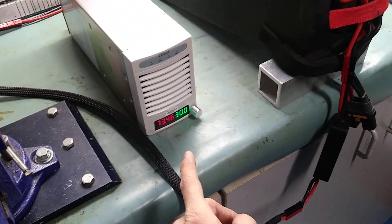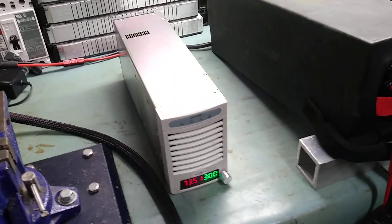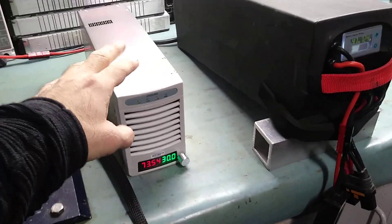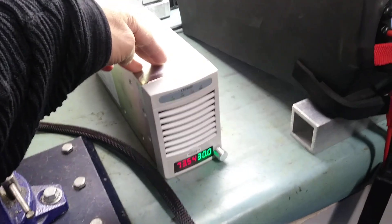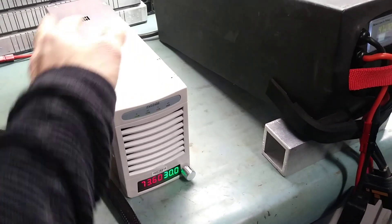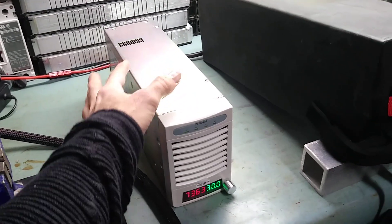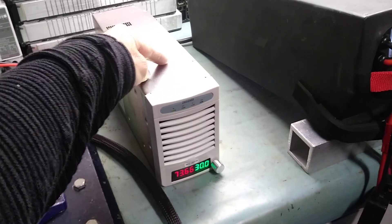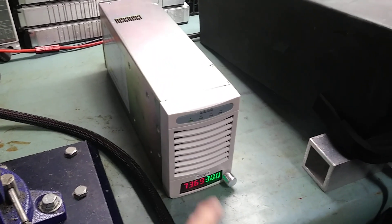So that's 3 kilowatts versus 600 watts. I like this one because it's flexible — you can go from 0 to 125 volts, 0 to 30 amps. It's a very flexible charger for all kinds of e-bikes or any project you have. I bought it on eBay, and these are also available on Alibaba. If you have more time and want to do it yourself, you can — this is actually a server power supply normally rated at 48 volts 50 amps for data centers, but it's been modified by Chinese manufacturers to achieve all those voltage and current ranges.